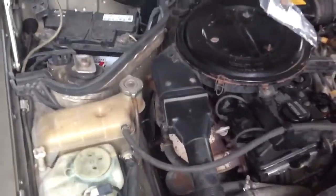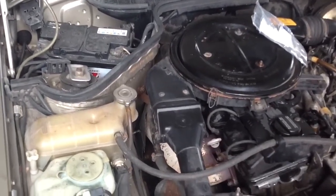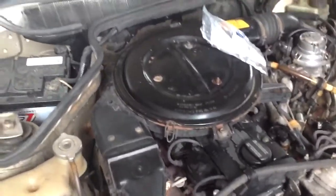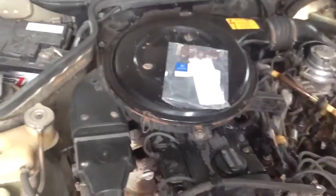I also saw some smoking at the back and I was starting to use oil. I've had it for 2000 kilometers now. My father-in-law had the same problem on his car — a six-cylinder S-Class with an M103 engine, which is pretty much the same as this M102. He changed the valve stem seals on his car, so I'm going to do the same on this one, as I think it has the same problem.